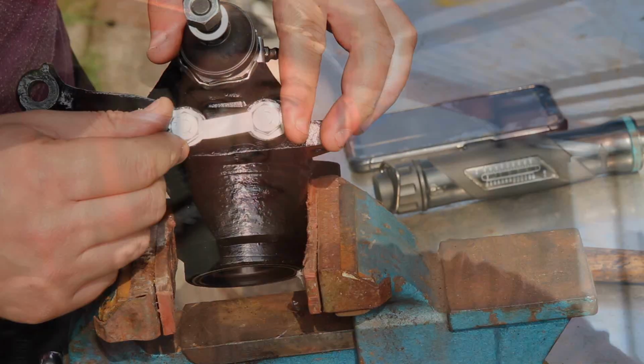That's it. Capiche? Okay, so that was just a short one today. We've got those steering arm lock tabs now fitted, and I think that is the end of the torquing of the bits up for the swivel hub. Next steps are to fit the disc, the caliper and the brake line. Obviously they're going to have to come back off again when they get fitted to the car, but I'm going to fit them up just to show you guys exactly how that works.